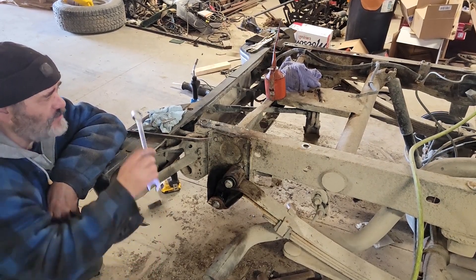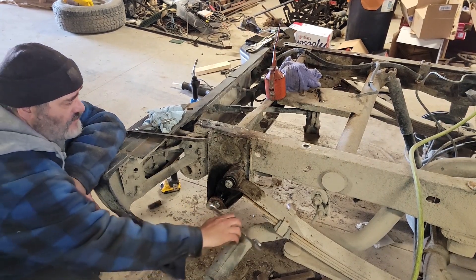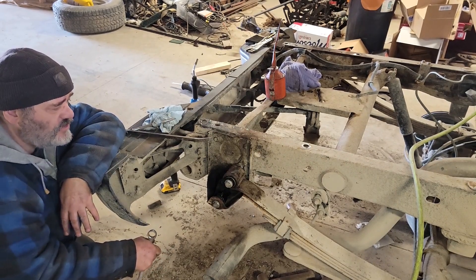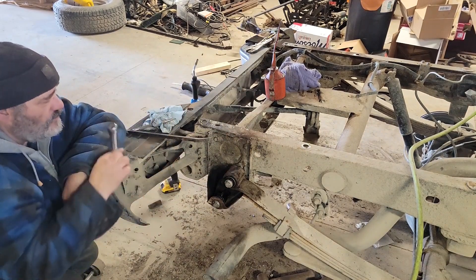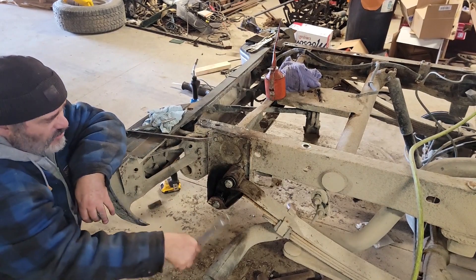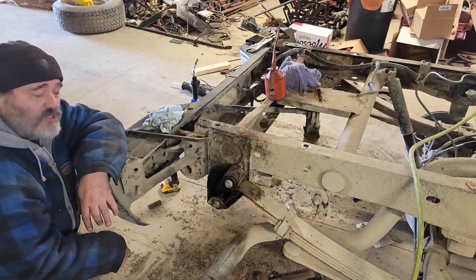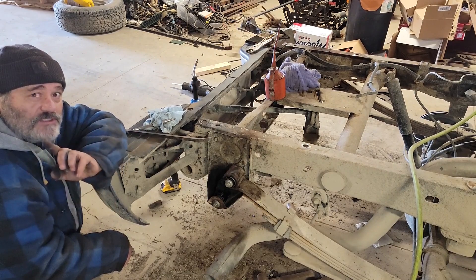Obviously pulling the box was just a convenience issue — you can do this without pulling the box, but I can't really imagine going through all the effort of cutting that lower bolt out the way I had to with normal tools if you don't pull the box. It would just make it way more work for yourself — for eight bolts, two for the gas cap, and unplugging the wires for the tail lights. A couple of hefty lads can pull that box off in no time and it makes it so much easier. You don't need a lift, you're not crawling on the ground. I would highly recommend pulling the box. Anyway, if you are going to take on the spring shackle, hopefully this gave you some ideas and how-to. Hey, like, comment and subscribe, and we'll see you on the next one.